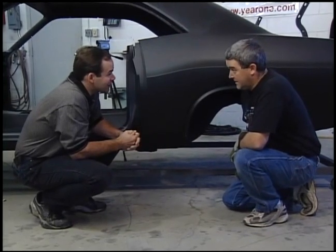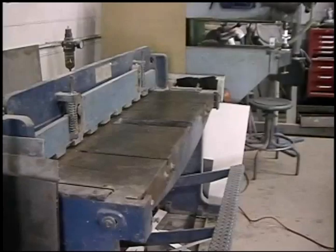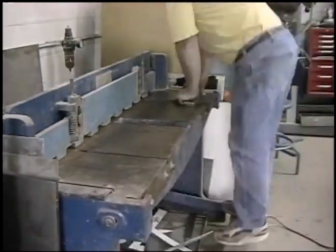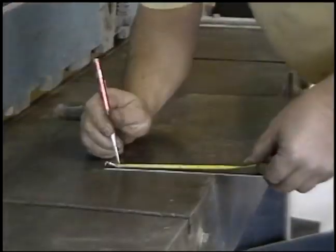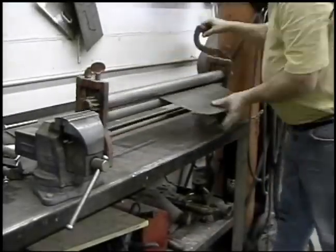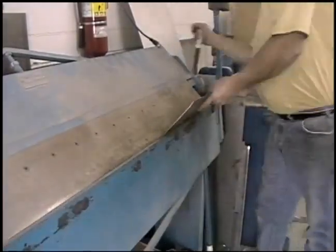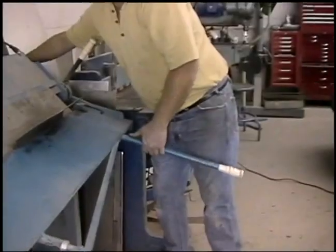Mark's coming in a couple of minutes. A couple of minutes? A couple of minutes. Oh, great. All I have to do is measure the panel, then I'll shear a piece to size, mark out the two straight bends that have to be bent, and roll it, bend the angles, bend that panel again.